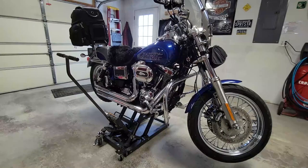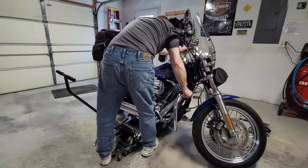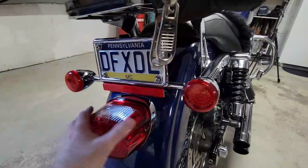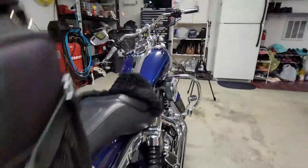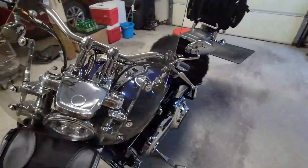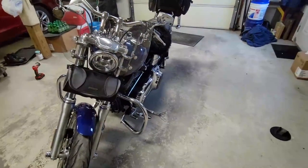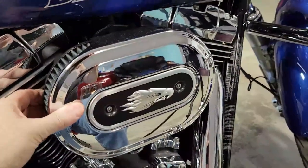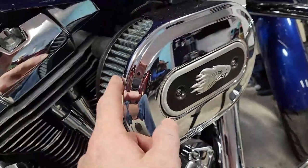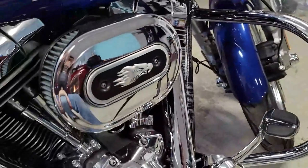I've looked at everything I wanted to check with the bike up on the jack. Now I'm going to lower it and do a few last things. After getting the bike down off the lift, I remembered to physically put your hands on the turn signals — they can be moved and aren't super tight on most bikes. You can also get someone to hold the bike up and check the alignment of the headlight to make sure it's pointing forward and not cocked to one side. The air cleaner should also be checked for tightness — I usually pop it off every few thousand miles to do the K&N re-oiling process and check the fasteners inside.